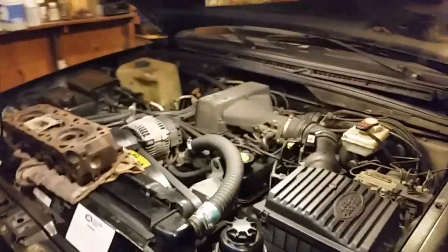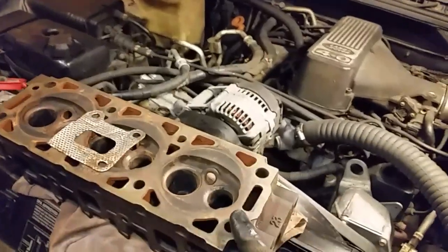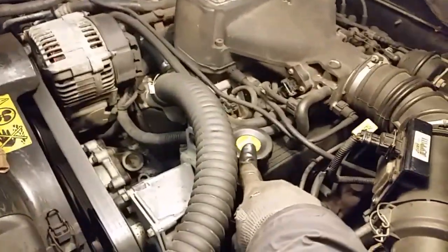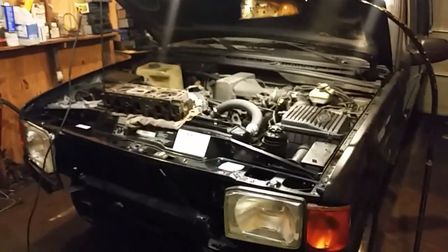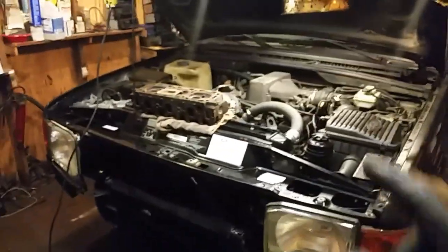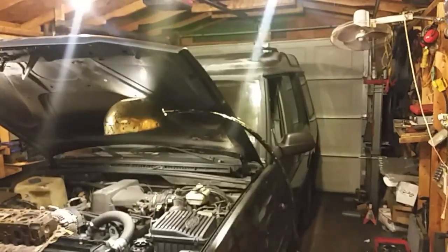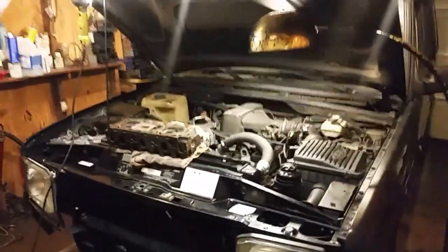Just a little tip if you're having overheating problems with your engine — in some extreme cases you can drive it a little bit to get home, just watch the temperature gauge. Make sure it doesn't get too hot, because you can get these heads so hot that they actually crack. Those are the three ways to find out if you have a blowing head gasket: your dipstick, your filler cap, and your reservoir for your engine coolant. I'm going to go ahead and start tearing this thing apart and give you guys an update later. I'm keeping my fingers crossed that it's just the head gaskets — if the slipped sleeve syndrome is present, this engine is pretty much done and it's going to turn into a boat anchor. I hope not because it's in pretty good shape. Wish me luck, I'll see you then, take care.